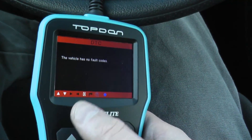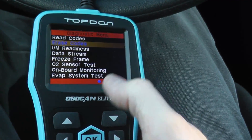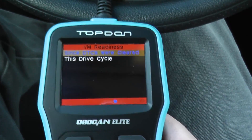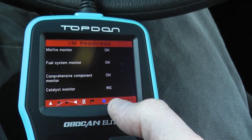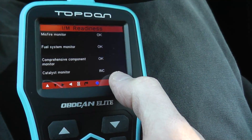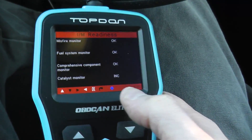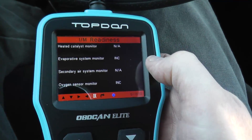The vehicle has no fault codes. If you had anything here — oxygen sensor, mass airflow sensor, idle air control valve, knock sensor — all of that would be listed here. And then if you wanted to erase the codes, you go to 'Erase Codes.' Now this is very important for anyone that lives in a state that's strict with emissions. If you ever disconnect your battery or erase trouble codes, it resets a bunch of different monitors inside your vehicle — misfire, fuel system, comprehensive component monitor. When we get down to 'Catalyst Monitor Incomplete,' that's a strike against this vehicle. Every state is different, but in New York, if you have more than one incomplete system for any vehicle after model year 2000, that would fail the emissions. You would not pass. And you still pay the fee, which is $37 in New York, once a year.